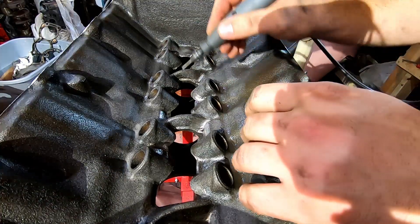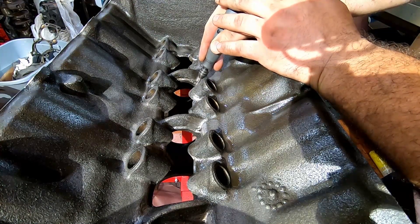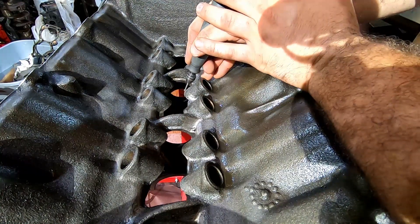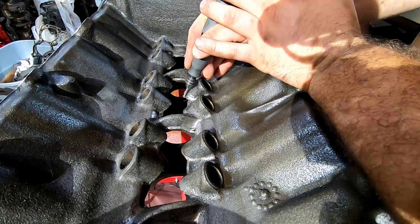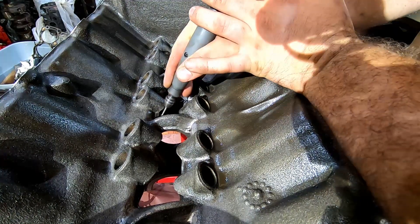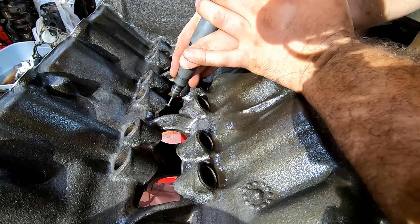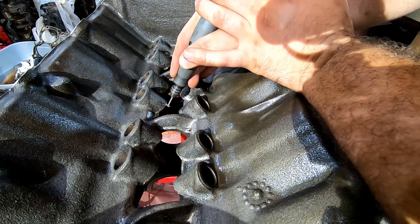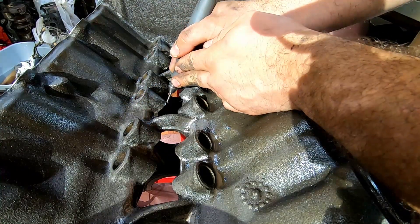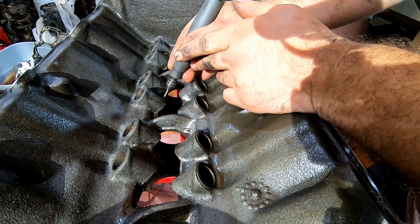You want to allow the tool to do the job. All you're going to do is ride the surface with it and that nice carbide blade will do it for you — just follow it, let the metal talk to you. If you see any imperfections, just give it a little touch, then round off the edge. Occasionally run your finger to check — if you have a sharp point right there, just barely touch the metal with the carbide.